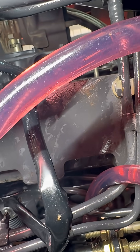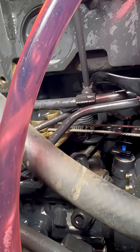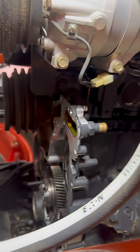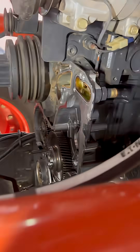We went about trying to locate that and replaced some dry-rotted fuel lines. We actually put a new transfer pump on it and it seemed to help — we got it to where it was sucking clear fuel, but it still wasn't quite right. It still had some white smoke, so we went ahead and yanked the injection pump off of it.